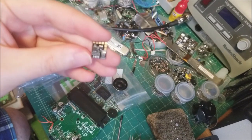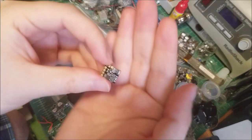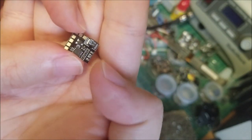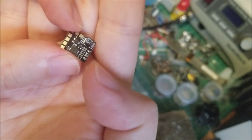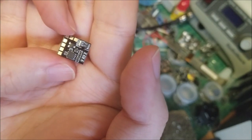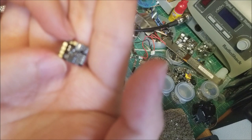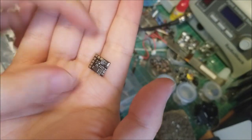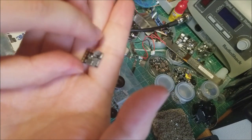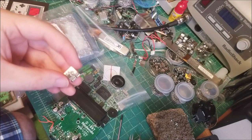There are two pads at the bottom that look like resistor pads with no resistor. If you short the top two together and the bottom two together, you can actually increase the loudness. I don't think I'm going to opt for that — I don't need a Game Boy that's super loud. On the default configuration, even the default of this should be quite a bit louder than the original speaker on the Game Boy.